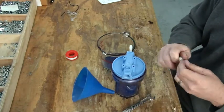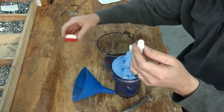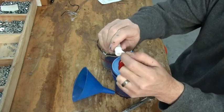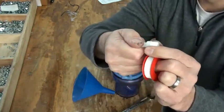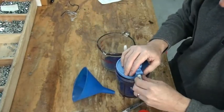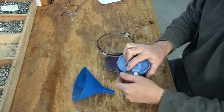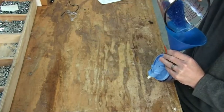At this point you want to take your straight barb and clean off the old Teflon tape. Put a new layer of Teflon tape on — if you have the fitting in your right hand, you want to turn your fitting clockwise and apply the Teflon tape, going around two or three turns, then break it off and install your fitting. Now we'll take our fitting off the output side and fill that side with beads — it should take the rest of your beads.